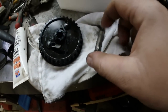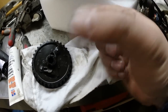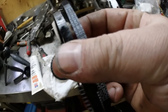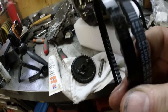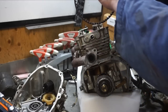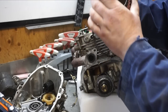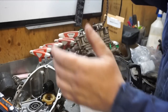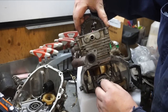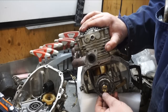Doing some inspection — looks like it's in pretty good shape. I also greased that pin up and inspected the o-ring, because that o-ring is going to act as a seal so oil doesn't leak out. We've got our new belt here compared to the old cracked-up one. Now we're ready to install it — we're going to put the new belt on, align the timing marks, and feed the belt down through the bottom.